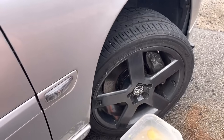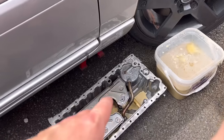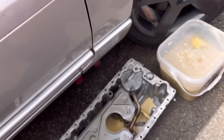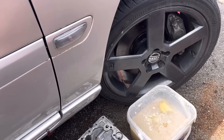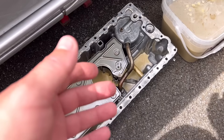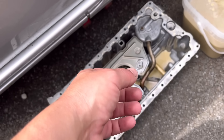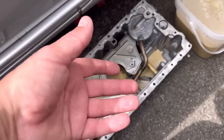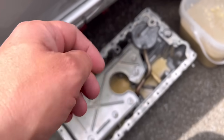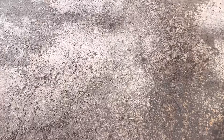So the reason it's down here on axle stands with the sump off — I said we'd wait a couple of days for it to drip as much as it's going to drip. What he's done is put an additive in the water that glows under UV light. I've got a UV light and I'm going to get underneath and have a look. We're looking for an oil stain or any UV lit area that may indicate a crack, as opposed to oil that's just splashed around underneath. So let me get my old body underneath.